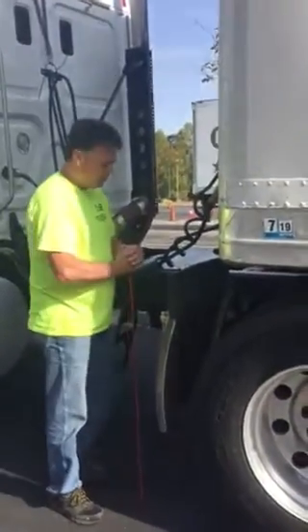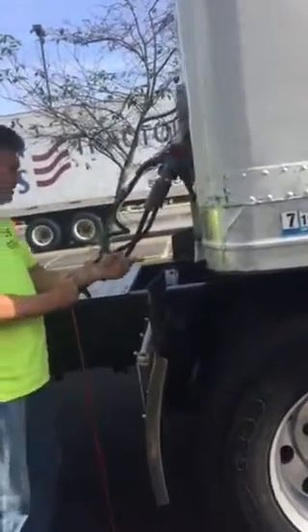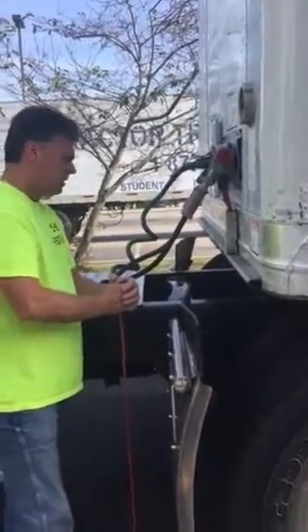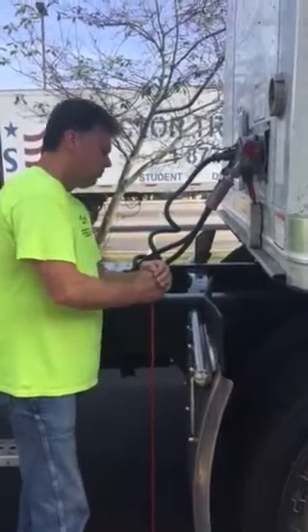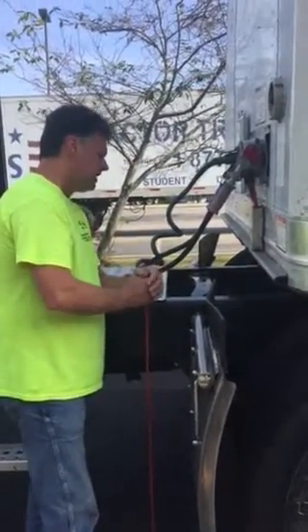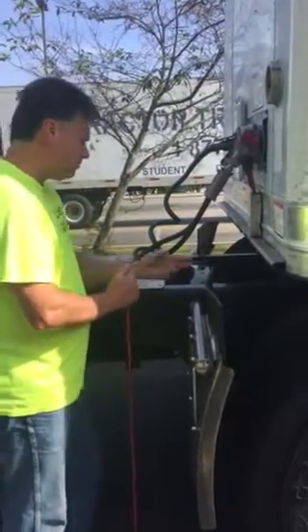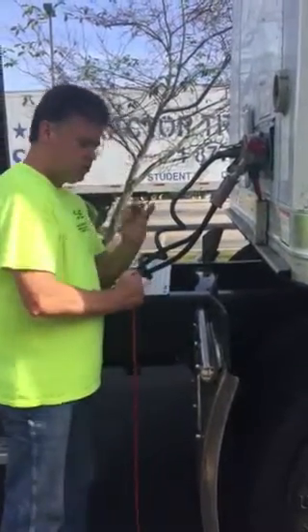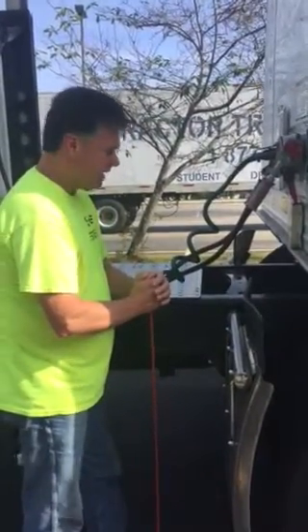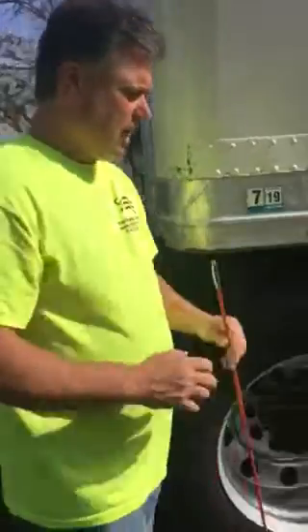From there, I'm going into my braking system for the second time. My brake hose is not cut, cracked, dry rot, or bulging, and I hear no leaks. My brake chamber is not bent, cracked, or broken, missing nuts, bolts, or screws, and I hear no leaks. My slack adjusters, push rod, and cotter pin are not bent, cracked, or broken, missing nuts, bolts, or screws. It sits at a 90-degree angle, and with the brakes released, you shouldn't be able to move it more than one inch. My brake liners — there's no excessive wear. My brake drums are not bent, cracked, or broken. There's no holes or welds other than factory, and they're free of any oil or grease.